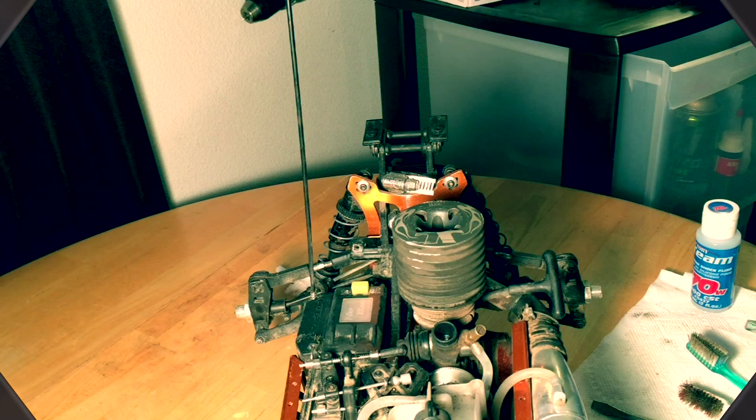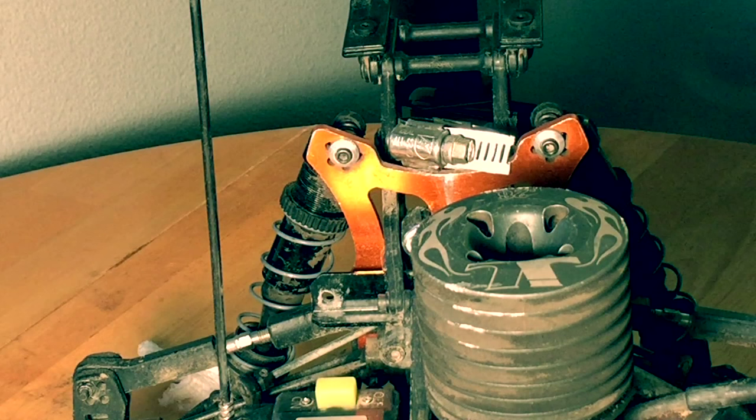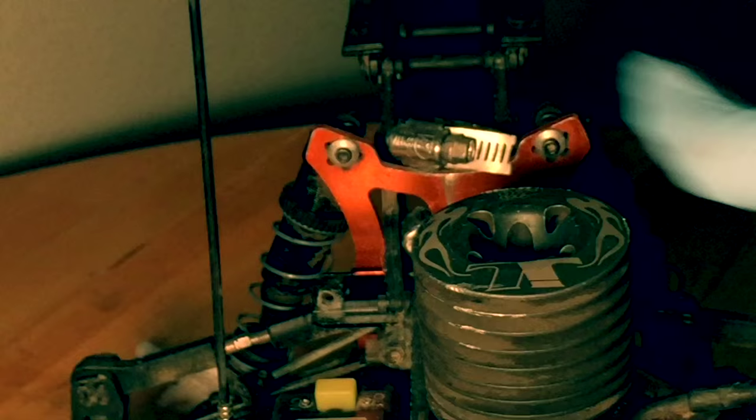Okay, now we come to the first step: taking our shocks off. I have the camera angled so you can see I don't have my back wheels on, which makes it easier to get to. There are two ways to get your shocks off — one less invasive and one quicker. The first way is to use an allen wrench, about 2.5 millimeters. I'm using an Ofna Hyper SS — everything is metric. You can use a Torx or an allen; in my opinion Torx doesn't strip screws as much. If you need to get at tough angles, use a ball-head allen wrench.